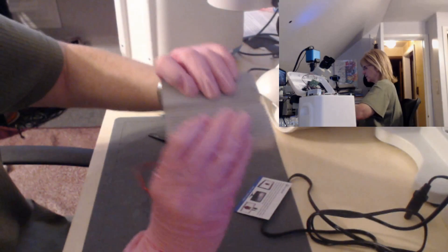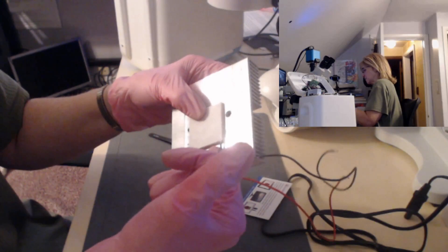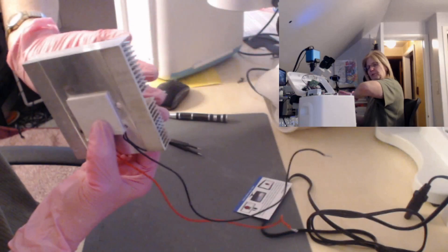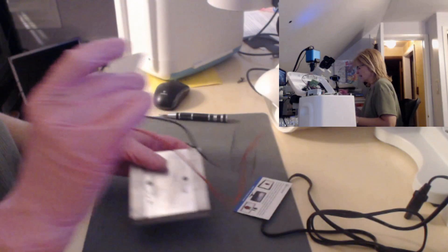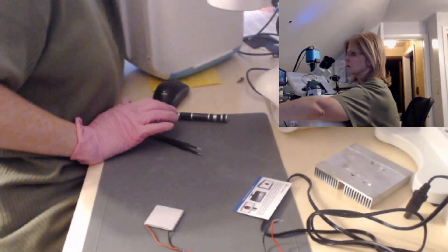When this was installed in the unit, this top side is going to be the cold side, and the heat transfers over to the bottom side. The heat sink absorbs the heat, and the fan mounted behind it blows the hot air away from the unit. There's normally thermal grease on here, so I'm going to clean off the thermal grease to make sure I get a good connection when testing this.